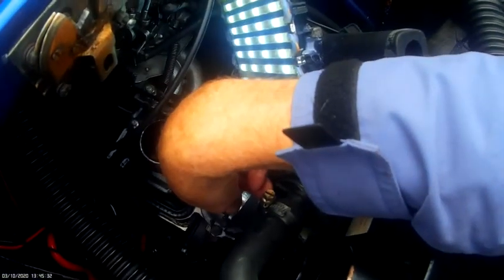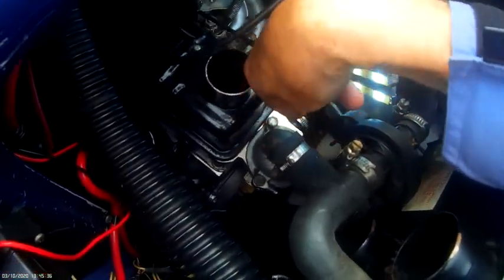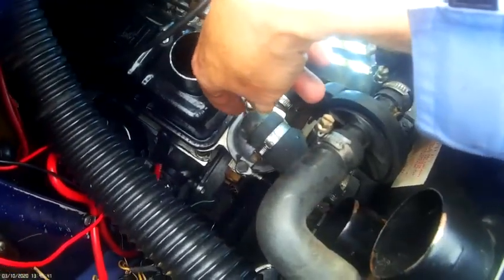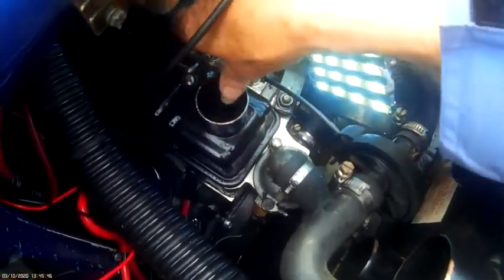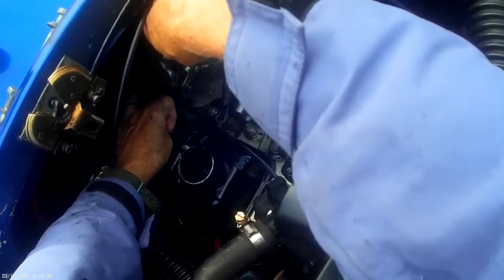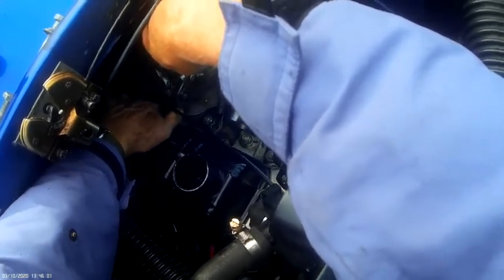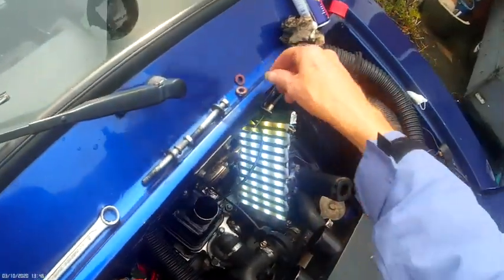to the top of the, what to call it, thermostat housing. It's right up close to there, or it is on this one anyway. I mean, yours might be a bit further away, but yeah, so slip the front on first and then put the back on after. And don't forget to get that piece of material back so it rests up against the rocker cover. As I say, it's imperative you make sure it's not trapped underneath it, alright?